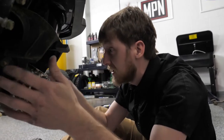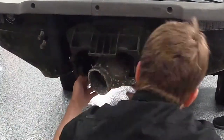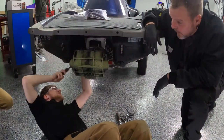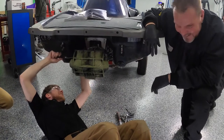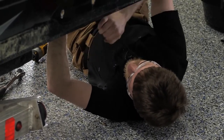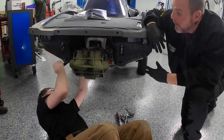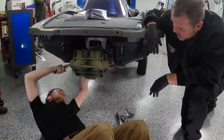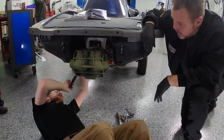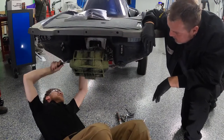Now we've got our steering link disconnected. It's time to drop our reverse bucket off — there's a whole bunch of 10mm bolts holding it up along each side. Every one of these bolts has got thread locker applied. They do use a lot of thread locker on these jet skis in many different areas, and the service manual tells you to reapply it to various components — that has a lot to do with the vibrations the jet ski experiences on the lake, ocean, or wherever you're running it.